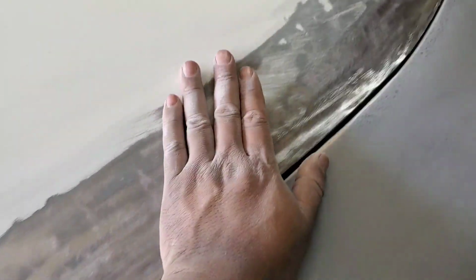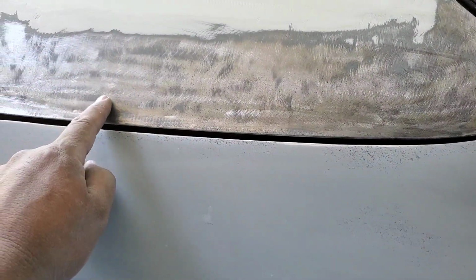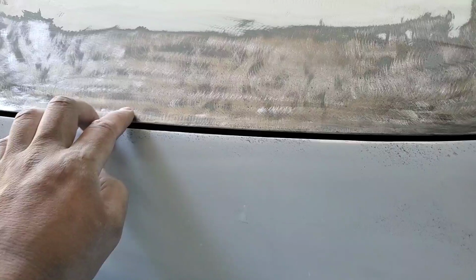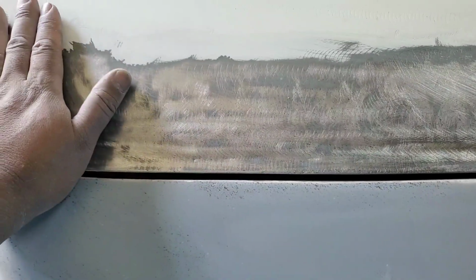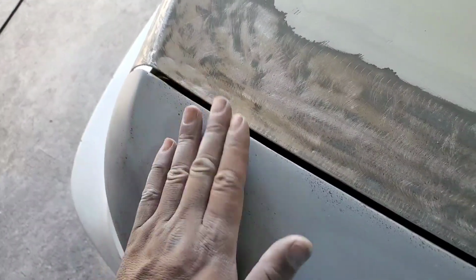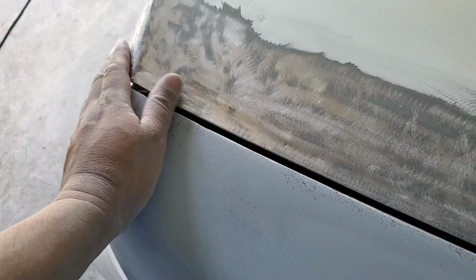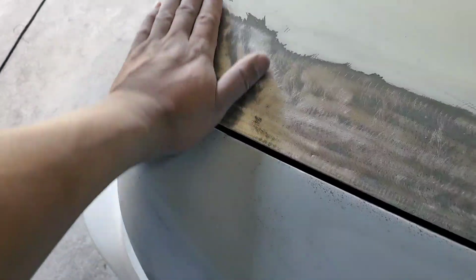Now it's time to wipe this here. If you rub your hands on it, what I'm feeling is this trunk likes to curve down, and right about there is the low spot. Then it jumps up to the higher edge that's been made to match up with this here. Careful around here. Obviously, that's a kind of signature look. There's kind of a little dip, almost like a ducktail kind of shape here. So don't go too high on this. You do want to accentuate this here. It's a nice look to this car.